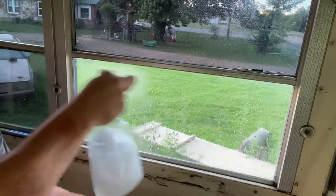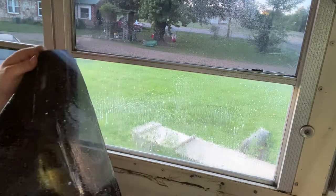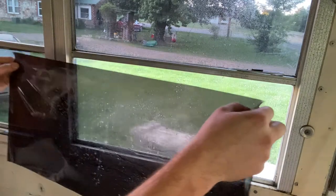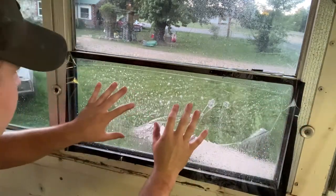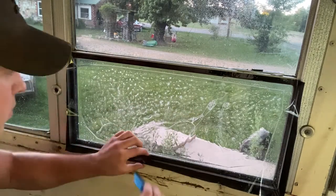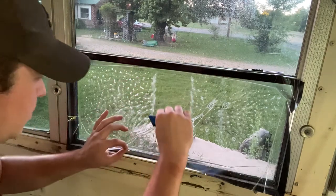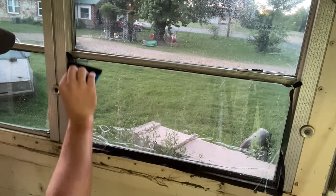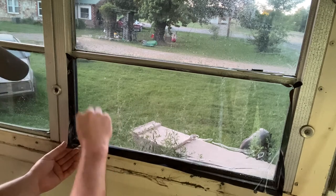The layer of water between it and the glass also makes it so that you can slide the film around and adjust it in place after it's made contact with the glass. Start in the middle, press that water out to the outsides. You'll notice I've left a pretty big tail on all 4 corners, extra material that needs to be cut off.